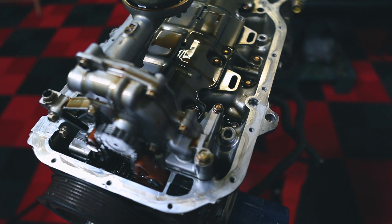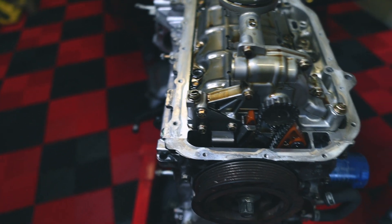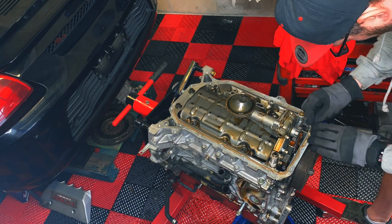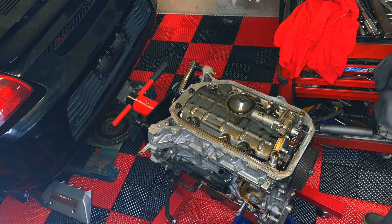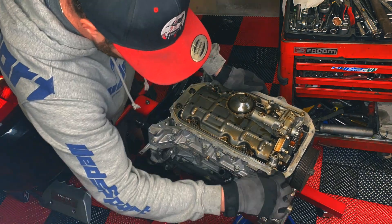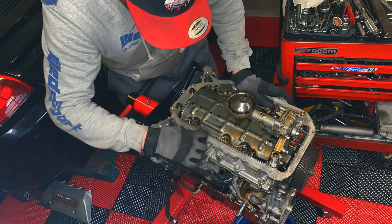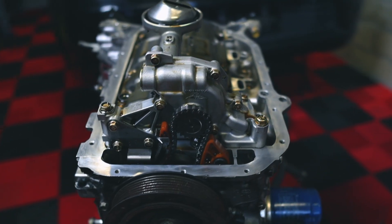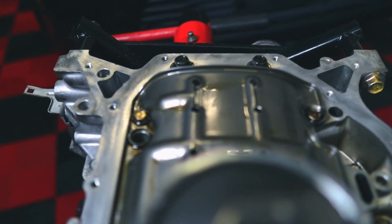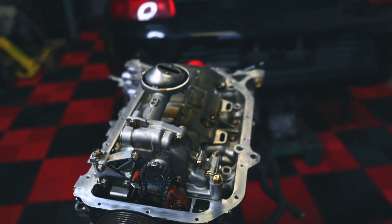As you can see now, there's a lot of Honda liquid gasket all over here, so we're going to be cleaning that up. I like using a razor blade like I did with my 2ZZ swap. The razor blade doesn't quite cut it for the whole procedure — it allows you to take off the big parts and make sure nothing falls into the engine while you're removing it, including bits from the old gasket. So make sure every single piece you remove falls out of the engine, not into it. Here you can see after cleaning it off with a rotary metal brush, you can get a super clean and nice surface that will allow you to have a gasket put on it.